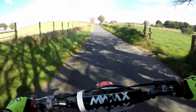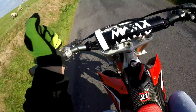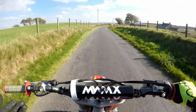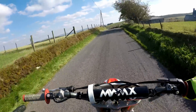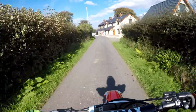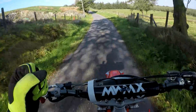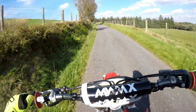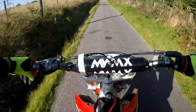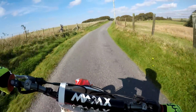What people get wrong sometimes is they compare a bike transmission to a car transmission. In a car, you have to use the clutch. If you don't use the clutch in a car and you just jam it into gear, it will absolutely smash your transmission to bits. But unlike a car, with these bikes you can only go 1 gear at a time. In a car you can put the clutch in and change from 1st to 5th if you wanted to. On a bike you have to do it 1 gear at a time. But these bikes are made to take abuse. When I change gear without using the clutch, I'll let off because you want to take some load off the transmission. You don't want to be fully loaded, because it's not good for the transmission. But like I said in number 4, you can keep it flat out and as the power's dropping off, you can change it and that's totally fine. I've had dirt bikes for years and not once have I ever blown a transmission, and I never ever use the clutch to change gear.